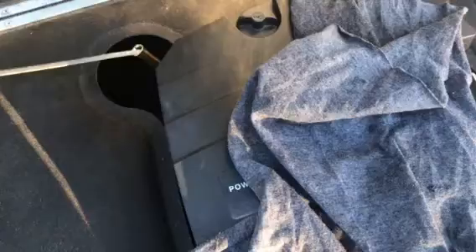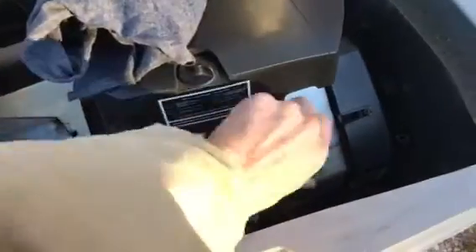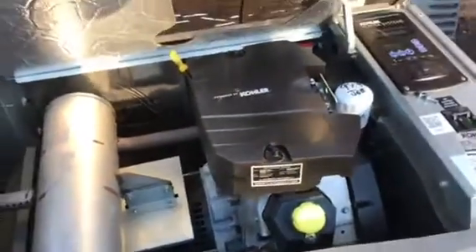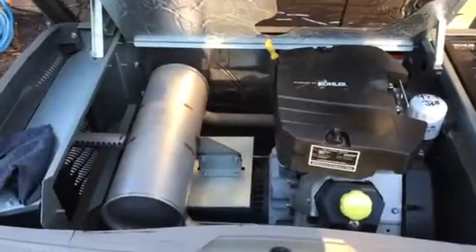I just added a quart to it. To add the oil, you take the cap off, put a funnel there so you don't spill oil down the front of the engine and make a mess. Add a little bit at a time until you reach the proper level.